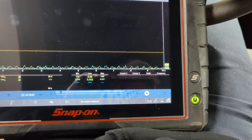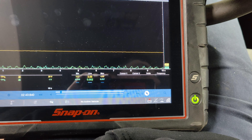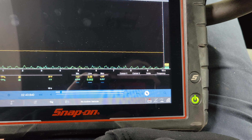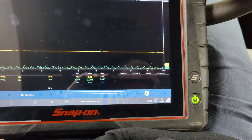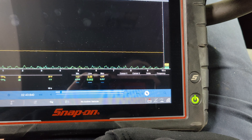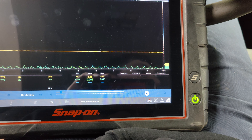So we've got to get this cluster out. We've got our scope set up right here. Here's our connector — look at this. If I just touch on this connector just a little bit right here, you can see — look at that, you just wiggled this connector right here. So when I'm wiggling it's making contact, so it's in this one. We're going to get this cluster apart real quick and check it. I re-soldered this connector — I didn't see anything loose, I was pushing on everything and looked at it under my microscope.